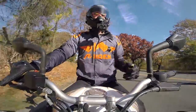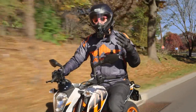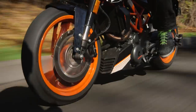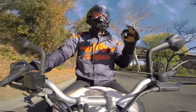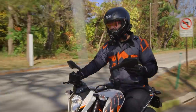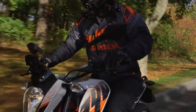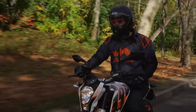As far as stopping is concerned, KTM does a great job — they use ByBre brakes, a company made by Brembo. Check out those calipers up front: this sets itself apart from other bikes in the 300cc class because you're looking at four-piston radial-mounted calipers. All the other bikes use two-piston calipers with a traditional mount, so the KTM is going to give you a bigger brake feel. Where I feel like KTM didn't complete the job, however, was with the levers. The brake lever and the clutch lever are cheap and chintzy — they move around and don't complete the good feel and feedback I was expecting from these brakes.